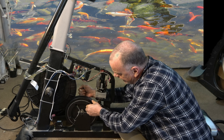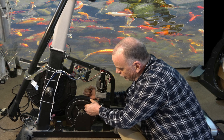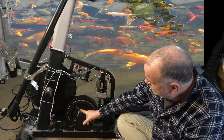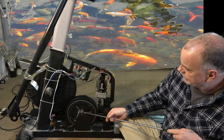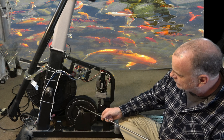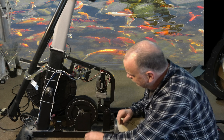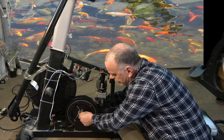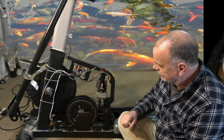I'm going to loosen this side a little and let it start to turn like that. Then you want to kind of hold the center of it so the whole thing doesn't spin around. It's also a good idea to pay attention to what clock position it is — the arm facing the actuator that pulls the magnets up and down. Just kind of pay attention to that, then loosen these bolts up here. You don't really need to completely remove them.